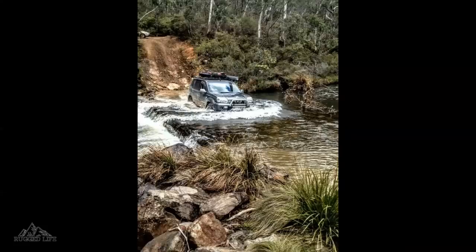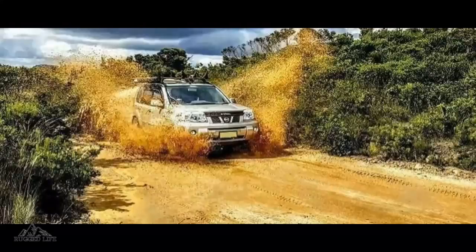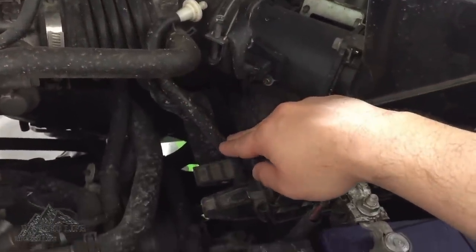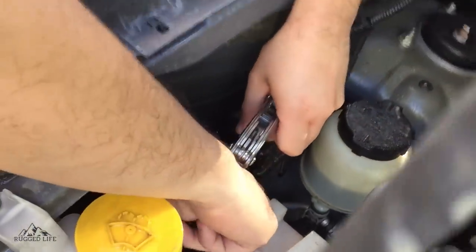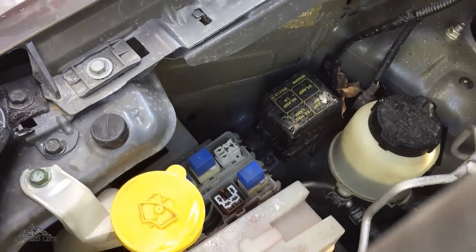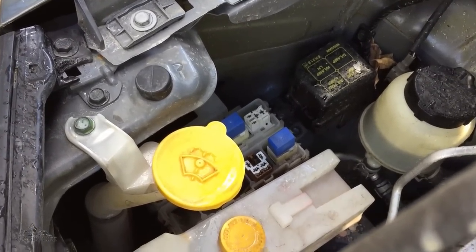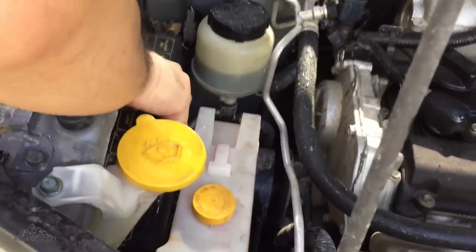There are a few things you can do to prepare your Nissan X-Trail for a water crossing that don't cost a lot of money. The first is to extend the differential and transaxle breathers — I have a video about this linked in the description below. The second thing is to locate the relay that controls the thermal fans of your radiator, and temporarily remove this relay before doing your water crossing. This prevents the fan from breaking and from spraying water everywhere in your engine bay. Whatever you do, please don't forget to put the relay back, otherwise you'll overheat your engine.